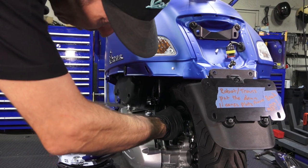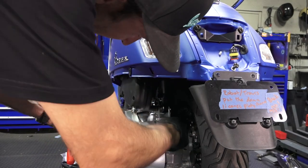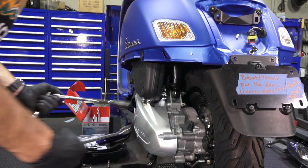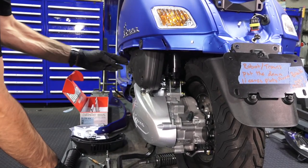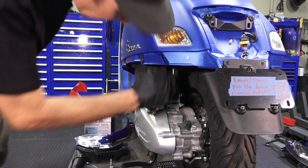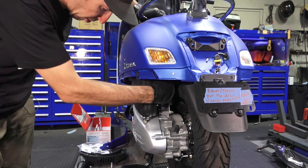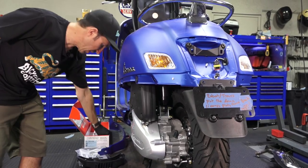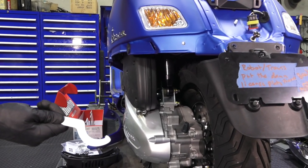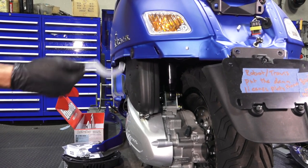Don't forget your last fastener — the left lower shock bolt. Again, torque it to about 25–30 foot-pounds using a 17mm combination wrench. Put the airbox back into place, but you may want to leave it loose for the first couple of test rides so you can make fine adjustments to your preload. With these aftermarket shocks, just like the original, you use a special spanner tool to spin the preload nut on the threaded shaft of the shock body.